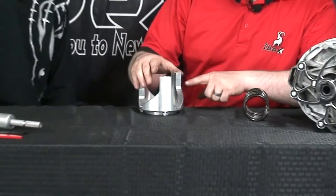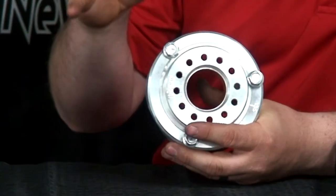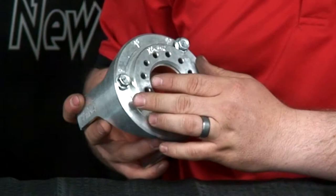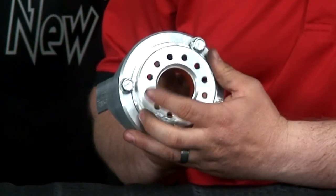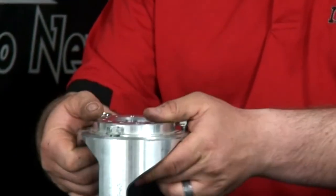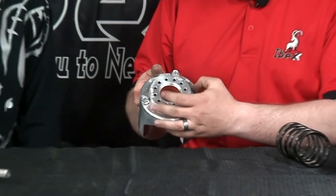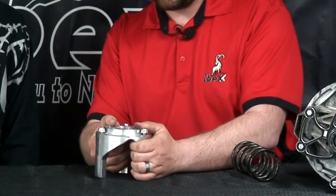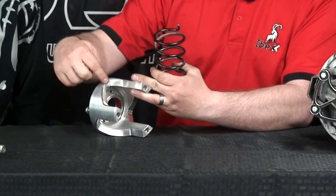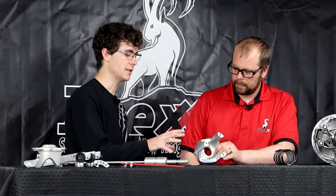The secondary helix is made up of the ramp and the cap. Some helixes are all one piece; this particular one is the one we offer with our Can-Am Stage 2 kit, and it has an adjustable cap that can be twisted to adjust the tension on the torsion spring. That's one particular advantage you get with the Ibex clutch kit — a full 360-degree adjustability of your torsion spring. That torsion spring is what maintains contact with the rollers on the ramp.